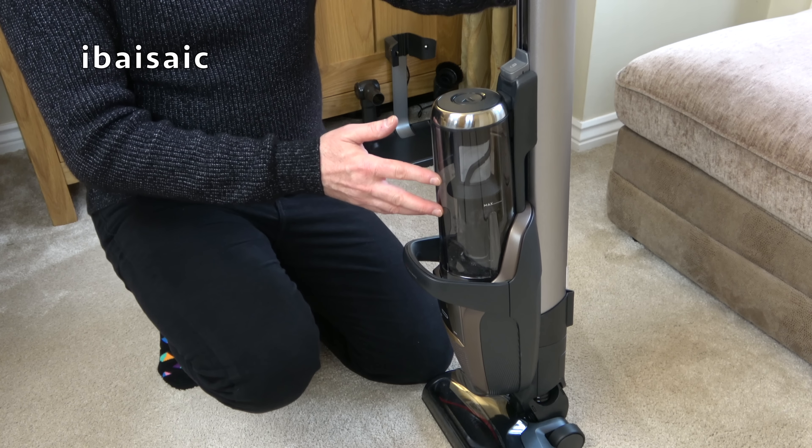There's some very fine powder which feels like Sebo Duo carpet cleaning powder I used on this carpet a long time ago — many different vacuum cleaners have been over this area since. But it is finding extra dirt, as you can see. There are filters that you need to maintain on this machine, as with all bagless cleaners. The filter that requires monthly cleaning is located at the base of the dust container, so you're going to get your hands dirty just to access it.